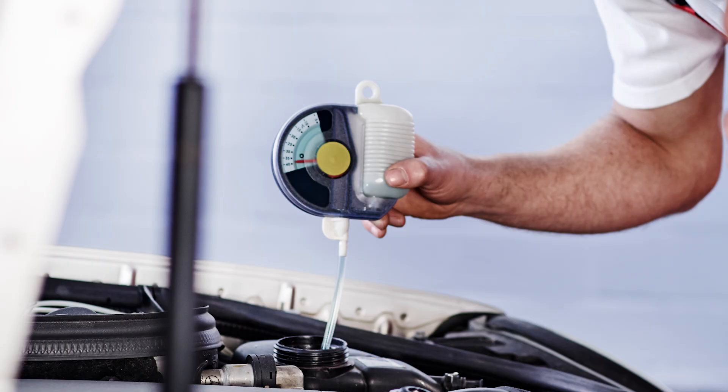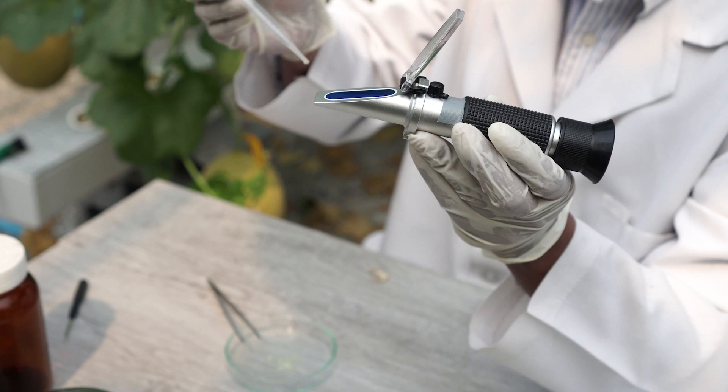Is reading it pretty simple? It is. There can be some complexity — some refractometers have an ethylene glycol scale, a propylene glycol scale, and a battery scale. Most common in our industry, for off-highway as well as on-highway, it is ethylene glycol. So as long as you just ignore the other two, you're fine. Now I will ask: in your float ball situation, was the brand new float ball reading correctly compared to your refractometer? It was close — but still not accurate.